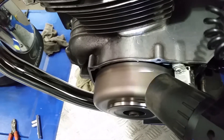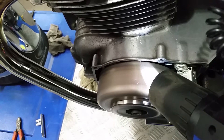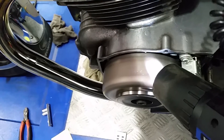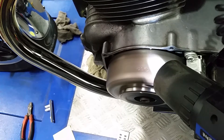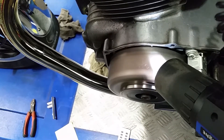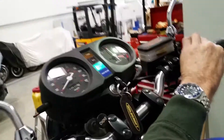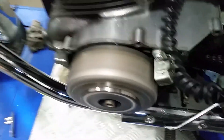The mark's moving — the ignition's moved around. That is round about five and a half thousand RPM. So this is a good CDI — good CDI.